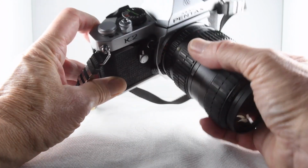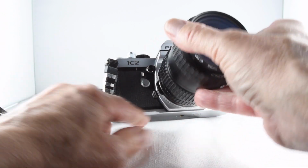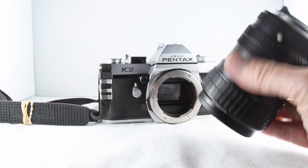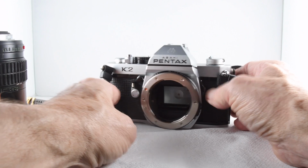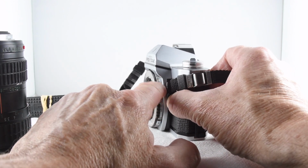So we have on the top, actually let's look at the lens release first of all. Lens release is in its usual position here for this sort of camera of this era. We're into the Pentax K mount here, manual focus. And while we've got that off, we have to just show you the slightly convoluted method of setting a film speed along this collar here.